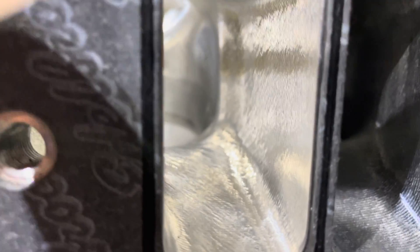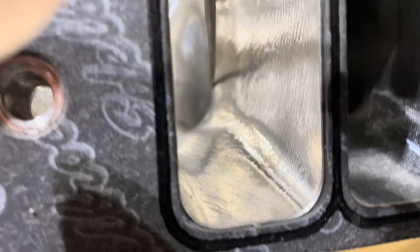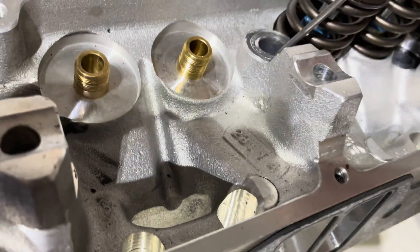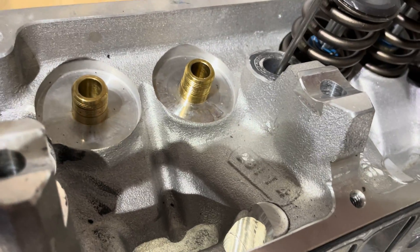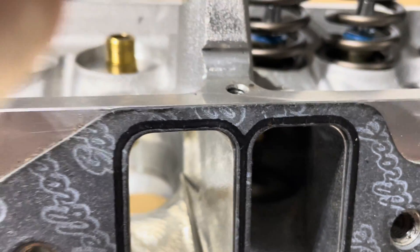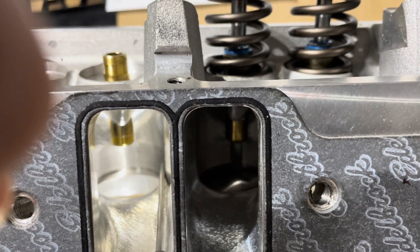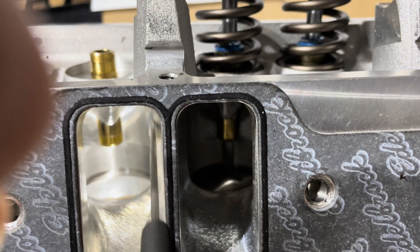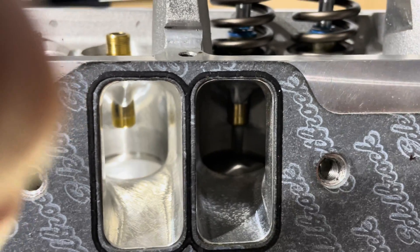One thing I thought Hughes might have gotten is right here — see where that point is? That's where the bolt goes to hold the cylinder head down. Other guys will sleeve this and then grind it flat. This common wall area — I've been told over and over — the flatter that is, the less obstruction. Most CFM will get out of it and you'll get some really good airflow going on in there.